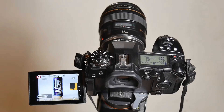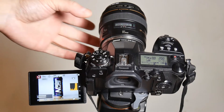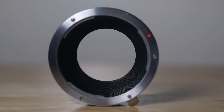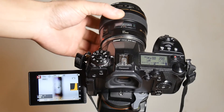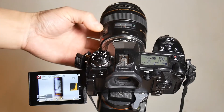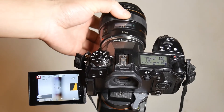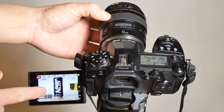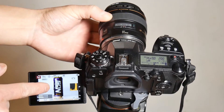To understand how a lens with a USM motor operates, let's use a Canon 85mm lens with a dumb adapter that does not have any signals. In this setup I can turn the focus ring and the lens is able to adjust focus manually, regardless of whether the switch on the lens is in AF or MF position. In addition, the camera was able to display focus peaking properly.